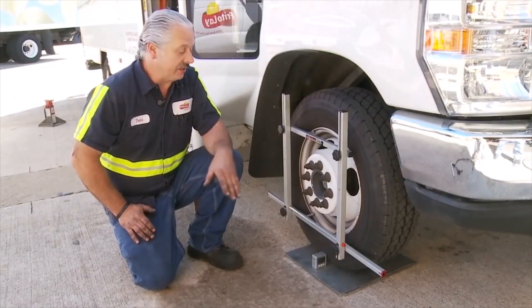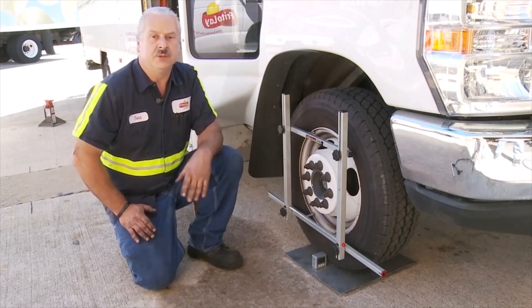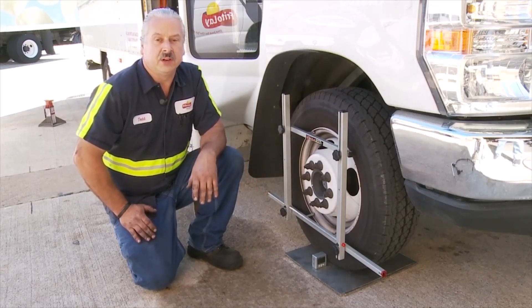This side sets up just as easily. Zero your gauge, put it on your frame, loosen your pinch bolt, adjust your insert, tighten your pinch bolt, and it should be zeroed out.